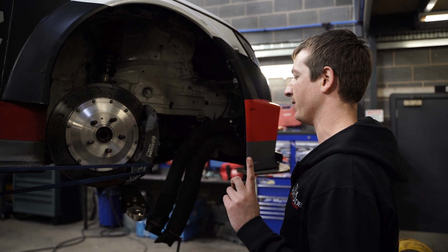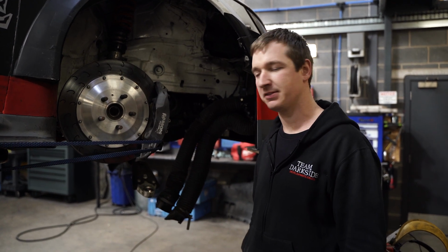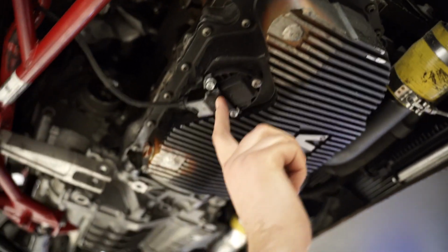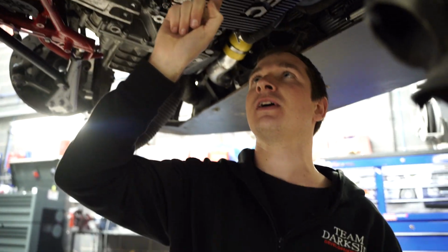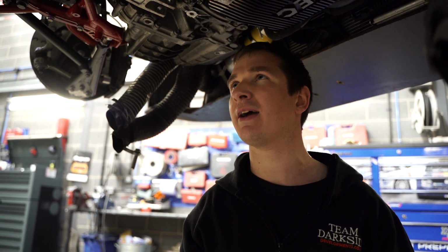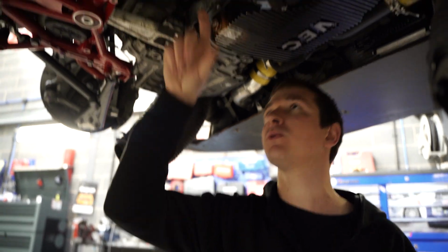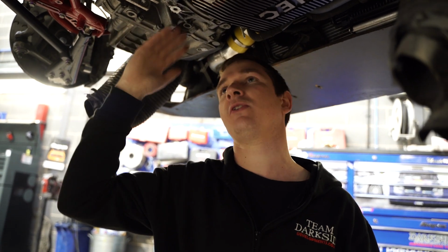So yeah, the other point, we've got the gearbox to go in. That shouldn't be too long. Can't remember what else Paul's been doing on this now. He's rewired this oil sensor and the plug, and then there's a little cover here that goes on the plug. So this grounded out at some point and damaged the wiring plug, but we've got that on there now, so that should stop that. And when that happened, it ground that out and it shorted the fusing, and that stopped the under piston cooling working, the variable oil pump or something like that. That fuse controls quite a few things that then put it into limp mode, which we don't want to have. So I think Paul's put a fuse in this somewhere, or we're going to put a fuse in it further up so that if we ever do ground this out again or smash it off, it blows that little fuse and not everything else.